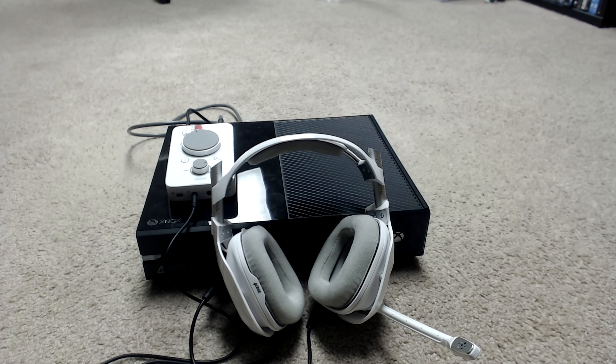Here we are in our computer. Go down to the corner where you see the headphones icon and click playback devices. Under here you're probably going to have Real Tek high definition audio, and now you'll have two new options: Astro Mix Amp Pro Game and Astro Mix Amp Pro Voice. Make sure you click Astro Mix Amp Pro Game and set it as both your default and default communication device by right-clicking on it. Then go over to your recording settings, go to your headset microphone, and set Astro Mix Amp Pro Voice as default and default communication there as well.